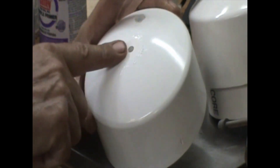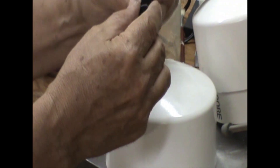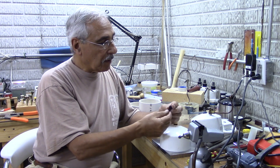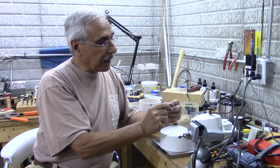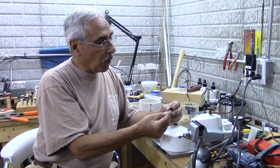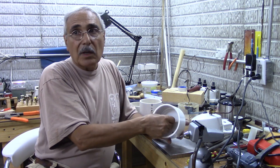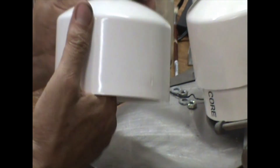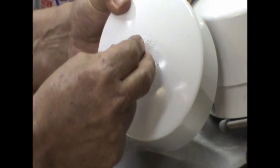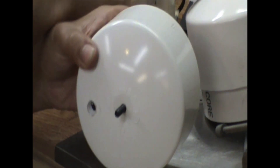To eliminate any leakage from that hole, I use rubber washers — I used two of them and a bolt. The bolt has a rubber washer on top, then a regular steel washer above that. It goes in from the bottom, and on the other side you put another rubber washer and steel washer, then tighten it down with a nut.